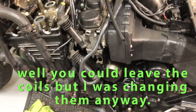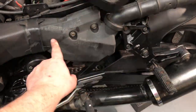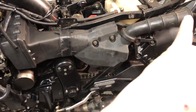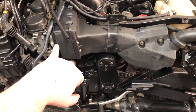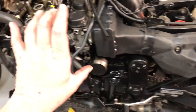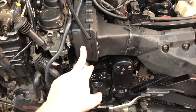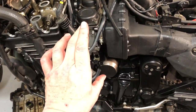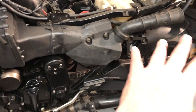Lift the coils out of the way. Air box snorkel and stuff. Move the existing air box back. Remove all four carburetors as one. Put your new air box on, put your carbs back in, air box stuff back on — snorkels, whatever.